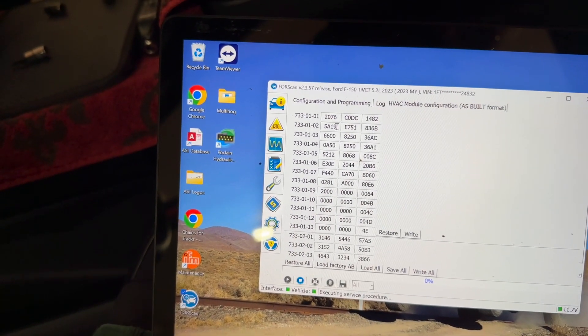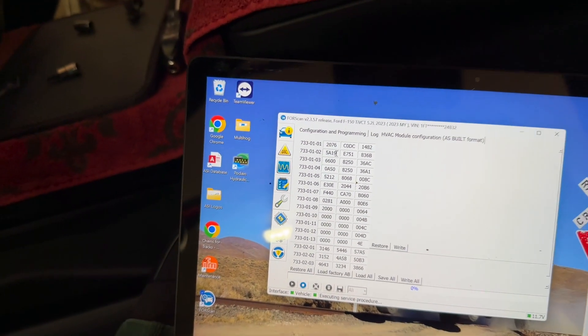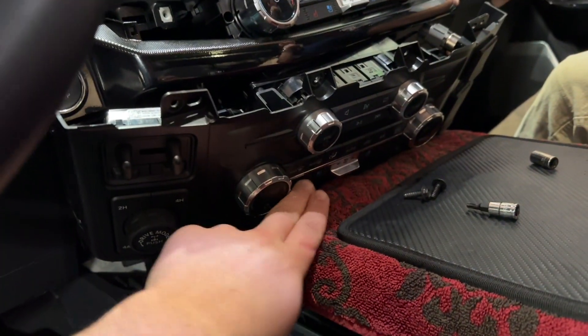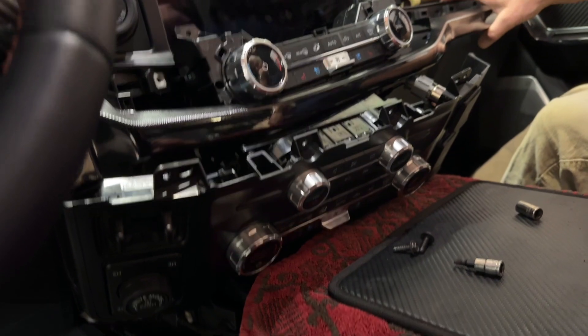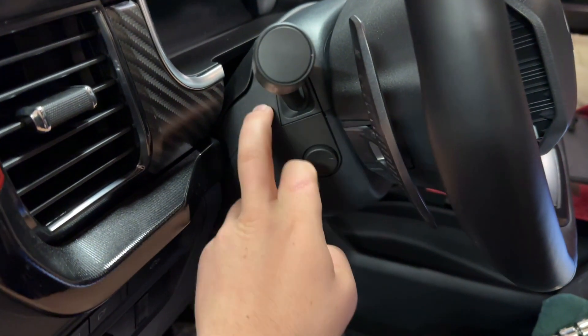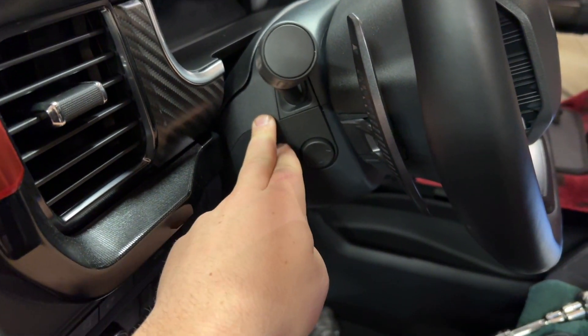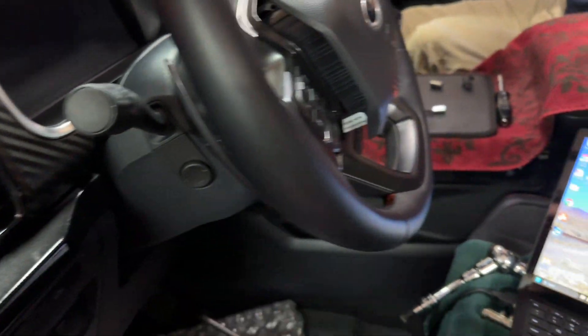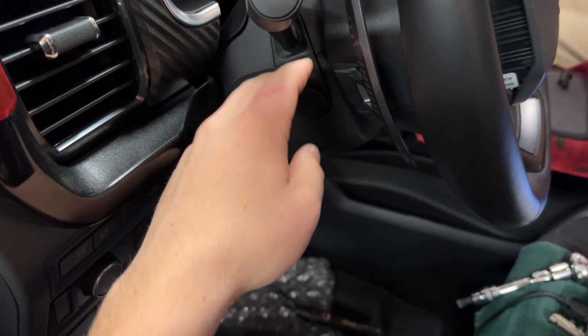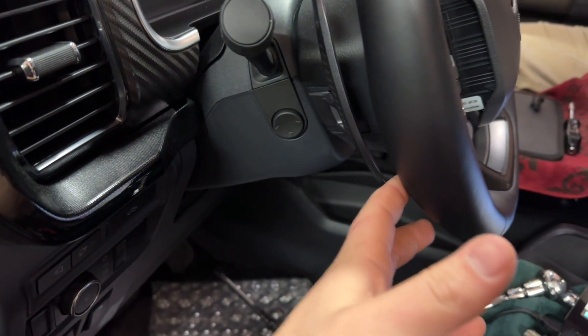It's this last digit, and for us it was a nine. On the Raptor R it's probably a safe bet it's all going to be a nine. That's just for the heated steering wheel — and to make the heated seats work, everything else works but just the heated seats. Now we have to grab the data off the steering column control module (SCCM). Here's the new one, which has the heated steering wheel plug. The one currently in the truck does not have the plug, so we're going to pull that off and swap them.